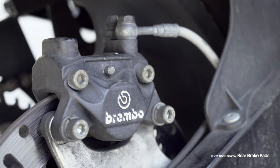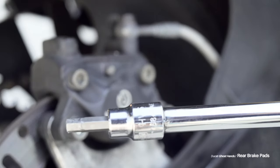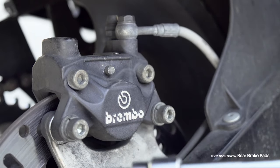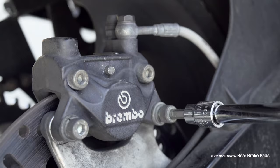To start, I had to remove two Allen bolts from the brake caliper — the bottom left and the bottom right. To do that I used this 6mm socket. You can't see the socket here because it can't really focus.